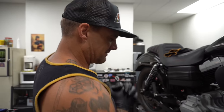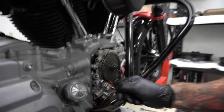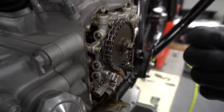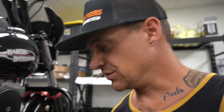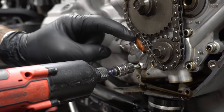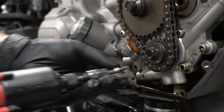I'll put some latex gloves on because oil doesn't only kill liberals — it also causes cancer. I really don't like getting my hands dirty. They have these little retainers that go in here, but everybody uses my toolbox and doesn't put my shit back. This is the hydraulic tensioner — we've got to take this guy out. You put a needle in here to keep this thing from shooting out and losing all the guts, because it is spring loaded.